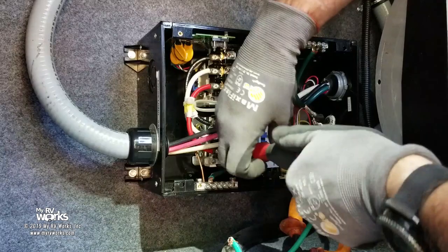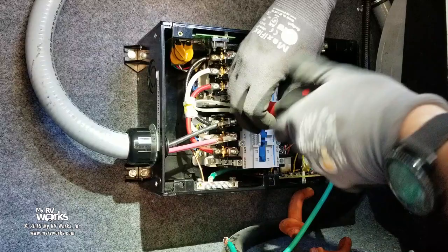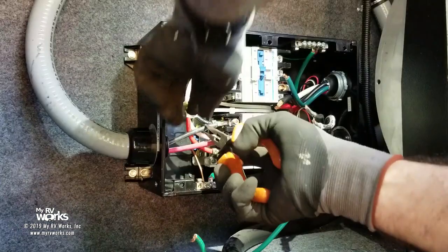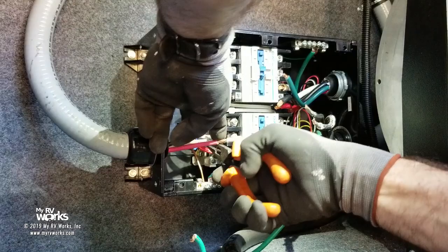And there's a thing called bucking phases. You won't be doing that, where your AC sine wave and their AC sine wave might be off a little bit, and you'll buck phases and have a big explosion. That's never fun. So let's see here. I'm going to leave you where you're at, but I am trying to get around you here. There we go. Okay, so he's in. And this guy, I want to make sure he gets seated right. Let me loosen that a little more.